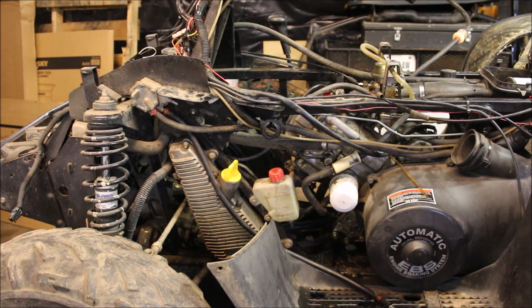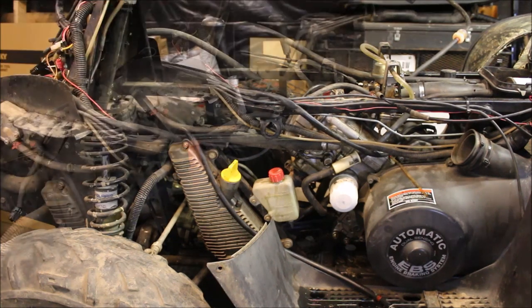There'd only be one other issue, would be the thermostat. Might be blocked off, and I checked that already. And oddly enough, the thermostat was messed up. The spring was really messed up when I pulled the thermostat out, so it wasn't opening and closing properly. At first, I thought that was the issue. I thought, oh, easy fix. Wrong. So, yep, I got a little coolant coming out of the exhaust, and bubbles coming out of the, I call it the puke tank. And we're gonna see what's going on.